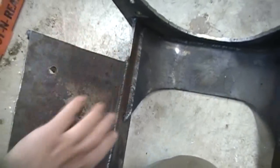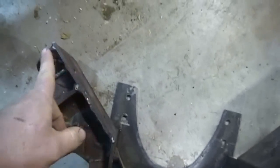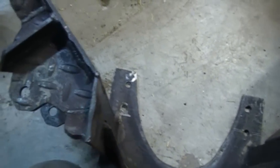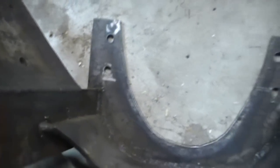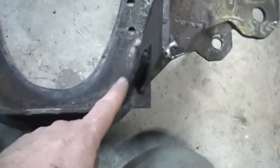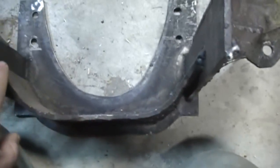I normally take and cut the back side of it — which I'll show you on this one — and re-weld it; I'm just making it a little bit thinner so you can bend it. Basically this piece goes up there and you bend it at that angle. The easiest way to do it is after grinding, just drill all the holes and guesstimate it until you get it where you want it, put it on the block, bolt it on, and then weld the seam back where you ground it so you can bend it. This little piece over there — I drill about a half-inch hole and bore out the mounts using half-inch bolts to make it a little more beefy. This piece will also have to be bent — just take the easy way out, take your torch, heat it here and bend it so it fits, then weld it in place. I weld everything on both sides that I can to make it as tough as possible.